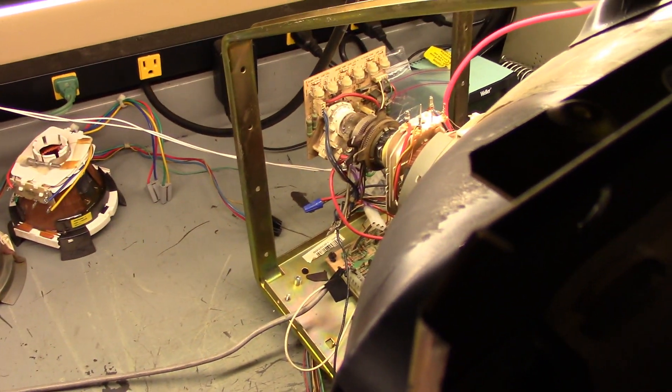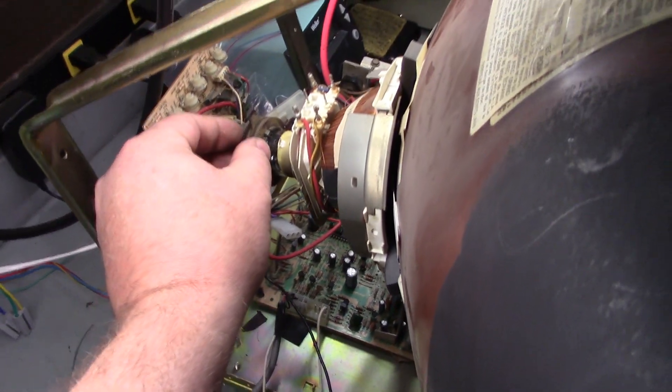Okay, that's not bad. Let me tighten this down — give me a moment and grab a screwdriver. Now I've got the ring assembly tight; it doesn't move anywhere. We'll get the camera on the tripod and get some adjustments made. Right off the bat it's not too bad, but we still have red bleeding on the top. First thing to do is turn our contrast down, because sometimes if your contrast is too high it can give a false reading. We'll turn it down to roughly there and turn our brightness right about there.